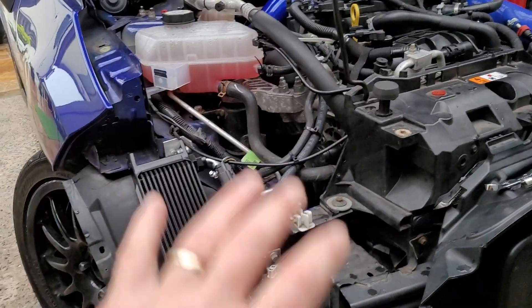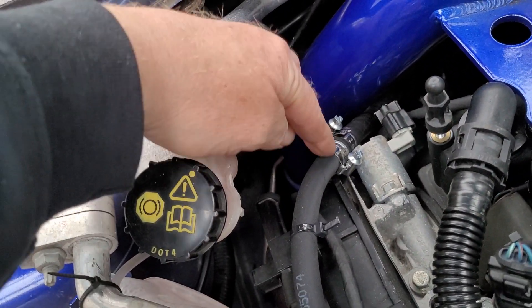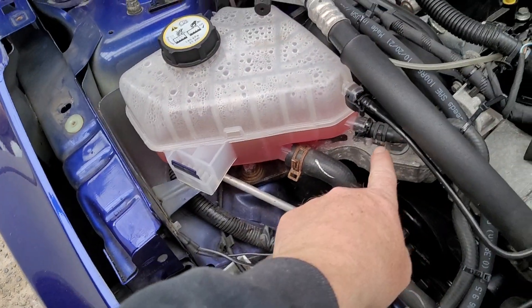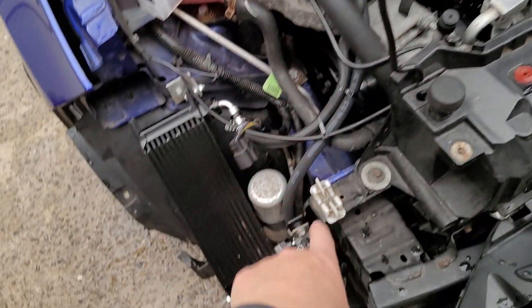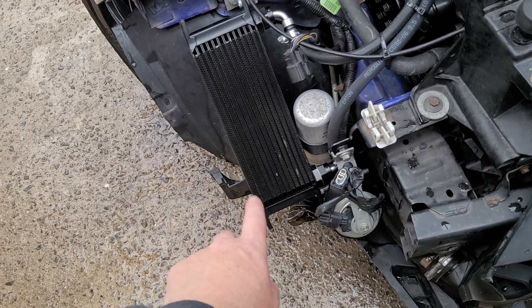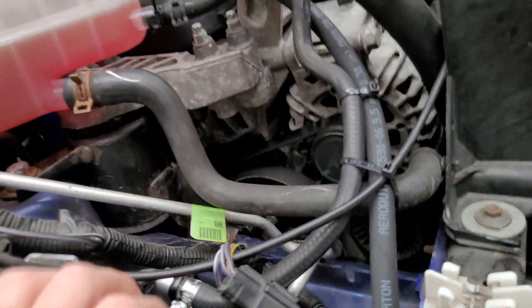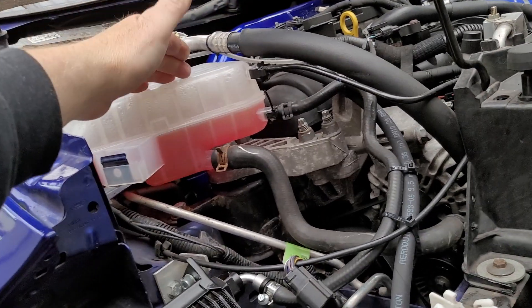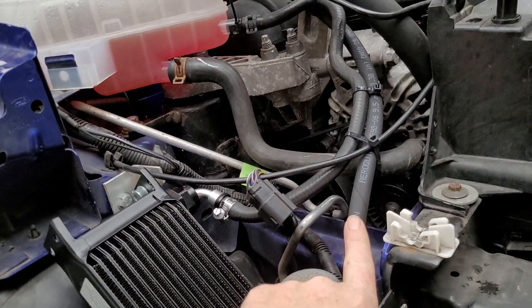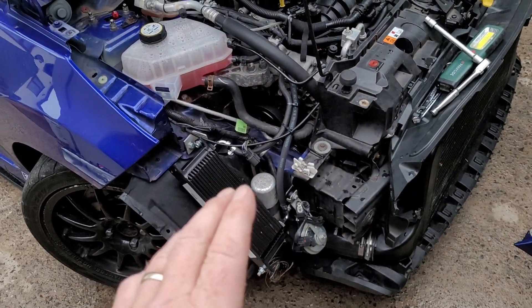Let me show you the plumbing. Your water will normally return from the turbo — that's the usual S280 connection — and that pipe would come straight back into your bottle. So water comes from the turbo, hot as hell, straight back into the bottle. But what it's doing now is: coming out of the turbo, going down into this cooler — which is an oil cooler but isn't being used as one today — then coming back out and going into the bottle. The original pipe reuses the standard hard line and my new hose comes from there, water in through the bottom and out through the top.